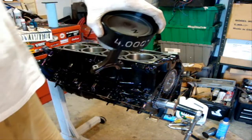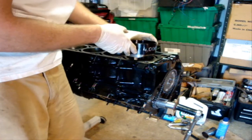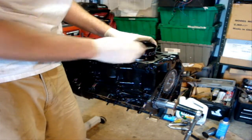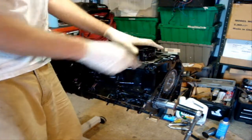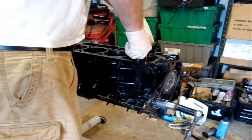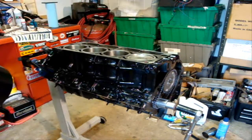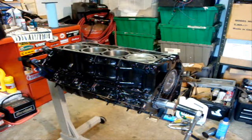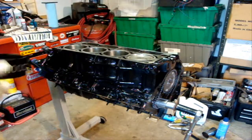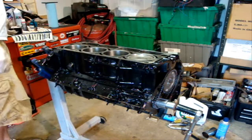I get it started in there until a little bit of the skirt pops out, and very carefully get it started. You have to give it a little twist and turn, and then I just kind of grab it, make sure it's seated, and then with my thumbs just give it a couple good pushes, and that's it. You feel a slight resistance when your rings hit the bore, but it doesn't even take a whack. I did one on the other side with the hammer and it just seemed like too much.